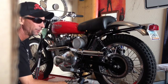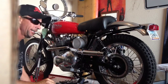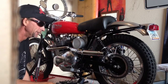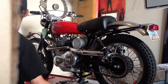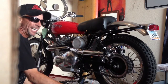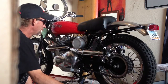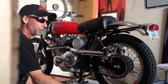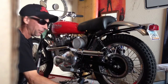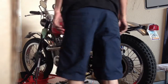I'm not sure what the problem is or what the problem was. I added a backup battery, hooked the leads up to it, to see if I could give it a little extra juice, and it seems to fire right up. In my opinion, I'm not sure the owner knows exactly how finicky these battery-less systems operate. I kind of think maybe the lights were left on when it was turned off, maybe drew what was little left in the power box, and it was unable to get a spark after that. Once it happened, it just wasn't happening.